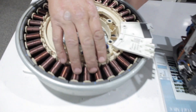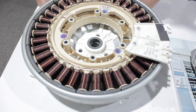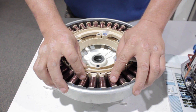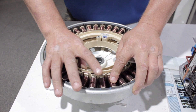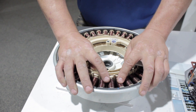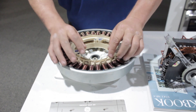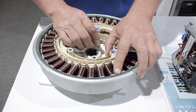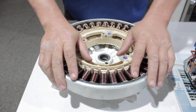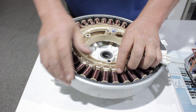We can see each three of these fit inside one of the magnets. I have a north and a south pole in my magnet. So whatever position it's in, I am going to either have one of these charged positively, charged negatively, or no charge whatsoever. And that is with DC current. It takes very little DC current to charge my wound coil. So right here, this is the north pole of my magnet, this is basically neutral middle, and this is my south pole. If I want my rotor to go this way, what I'm going to do is charge it.